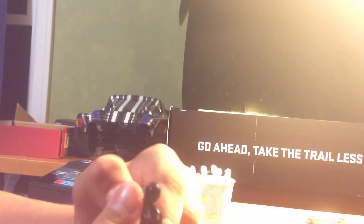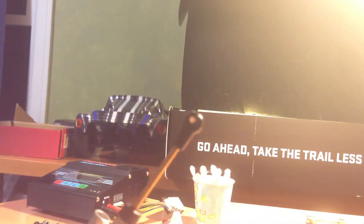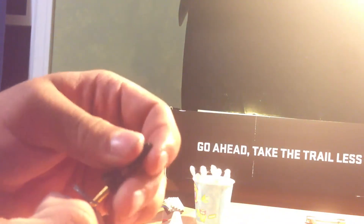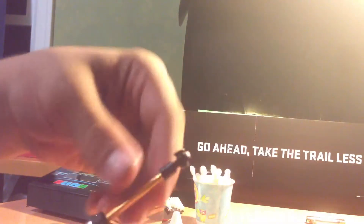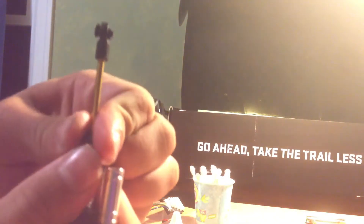So, to stop these shocks from leaking — because they're Axial shocks and they leak — what you would do is take the shock spring cup off, take that off, take the whole shock spring off, and see this bottom cap here — remove this.